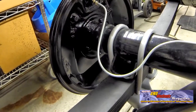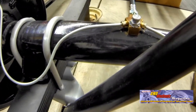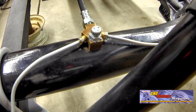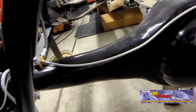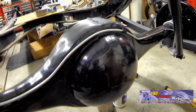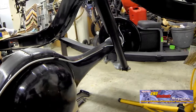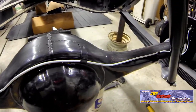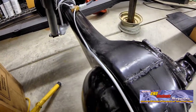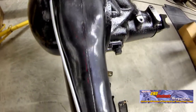The somewhat unusual loop in the tubing is actually an exact emulation of the factory bends. The long tube requires two clips along the axle housing to keep the tubing from flexing, vibrating, or moving. These clips were factory installed — they were spot welded to the axle housing. The routing of this tube from the Y to the right side brake is the exact location and pattern of the original equipment.